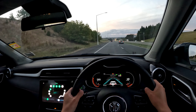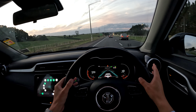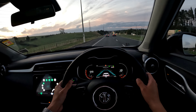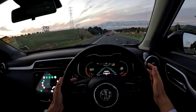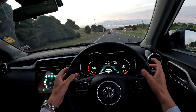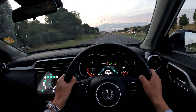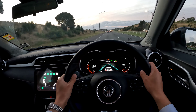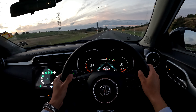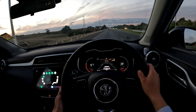I can definitely feel that turn. Everything at the back and in front of me is clear, so I'm going to let go of the steering for a couple of seconds. You can now see the vehicle steering turning on its own — just like that. I do not recommend you try this at home or on the road. This is just to demonstrate how the MG Pilot system works. You can see the vehicle is pulling me into the right centre of the lane — that's how the MG Pilot works. It will eventually tell you to keep your hands on the steering. To cancel it at any stage, put your foot on the brake, or a light touch forward on the switch to cancel the MG Pilot.